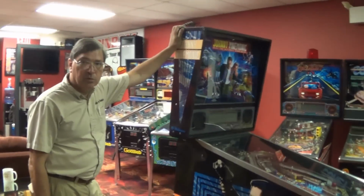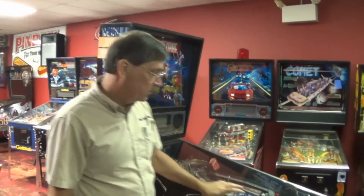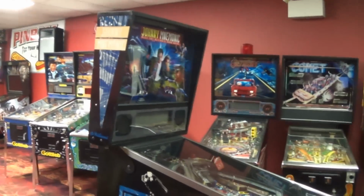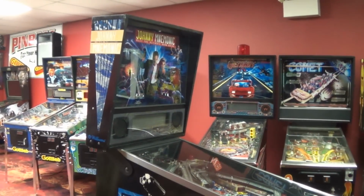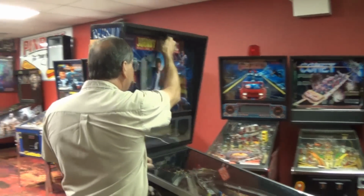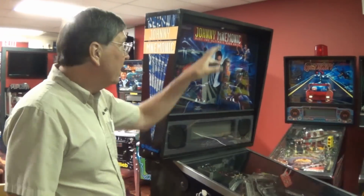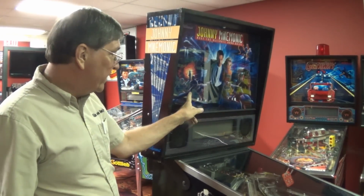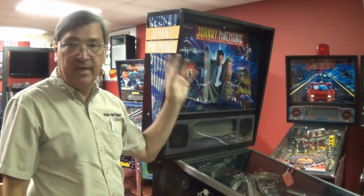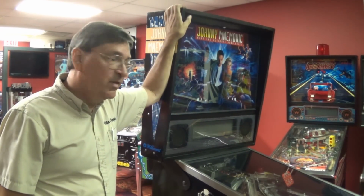You're going to need the back box key. Correct. You're going to go into the back box, which I guess is where we have to start here, because we can't go into the back box without going into the back box. Key, where it's supposed to be. There's a lock up there too. If your game doesn't have a lock there, that's a shame. Without this lock, this will take a hike and this will take a hike when you tilt the head down. Don't ask us how to move that without it, because it's a nightmare on one of these games.